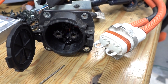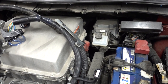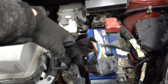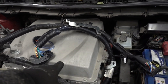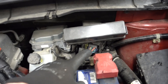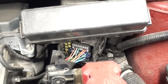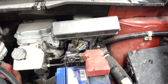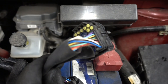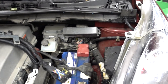But it's not as simple as just adding these two components. Before I go swapping the parts, let me show you the real problem. Nissan, in their infinite wisdom, decided that the wiring loom should also differ between these two. This wiring loom right here goes between the power distribution module, loops around and connects to various sensors, then joins this bigger wiring loom. If you zoom in, you can see the top row is not populated — and that is an issue. The new wiring harness has nine more cables compared to the old one.